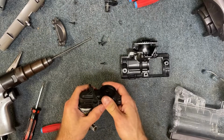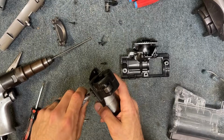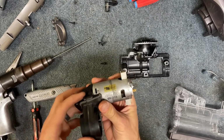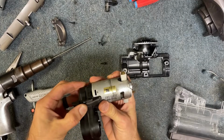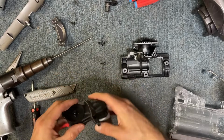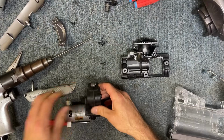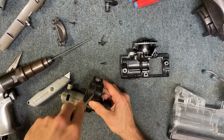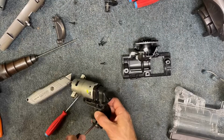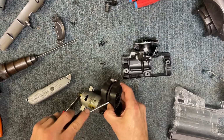All right, now there's a little gasket that you can just slice right here on where the seam is. As you pull this apart, you'll see the seam separate there, and you can just cut that. But you're gonna pull these 2 things apart here. What you can do if you want to is you can stick this in here and just very carefully pry it apart and kind of work carefully around with a flat screwdriver until this thing pops loose.